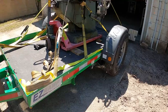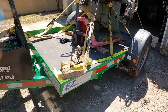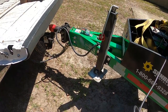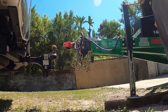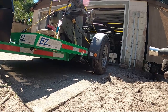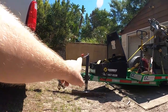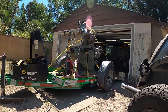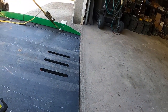We'll drop the trailer down. I want less of an incline than this — I'll be using a winch — so I'm going to drop the tongue of the trailer down also. I found it's possible to lower the tongue so much that the deck doesn't hit the ground in the rear, so of course that's a no-go.